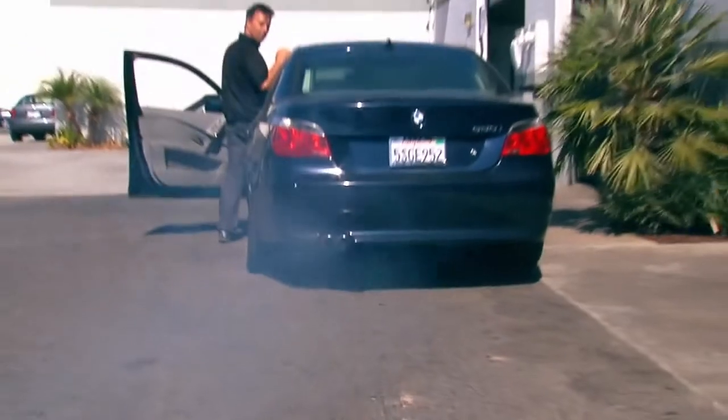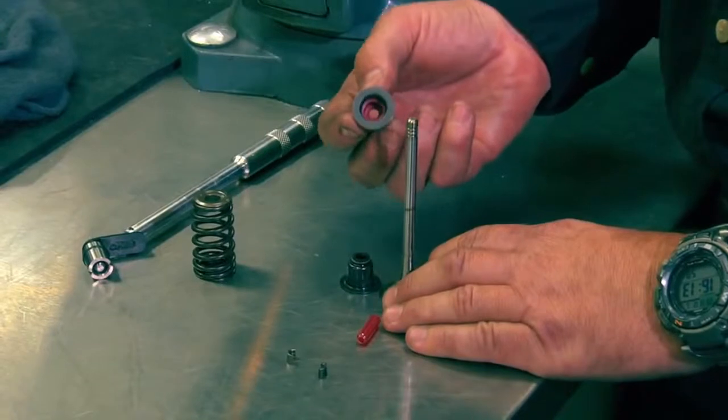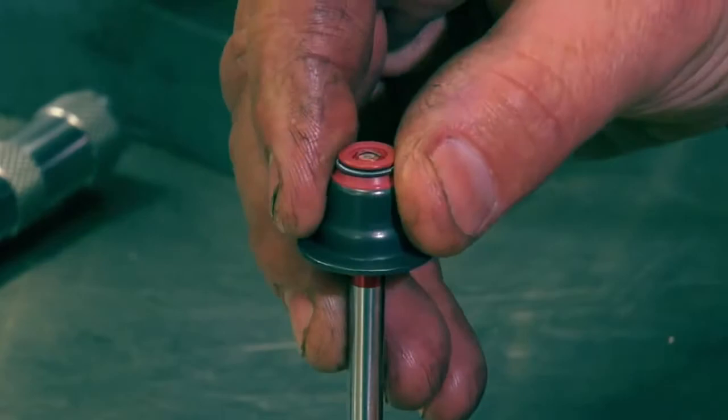This creates an oil pocket underneath the seal where oil can accumulate and make the problem worse. When you install the new seal, it will obviously eliminate the smoking, which — if the car has gotten to that point — is really excessive oil entering into the combustion chamber and through the exhaust.